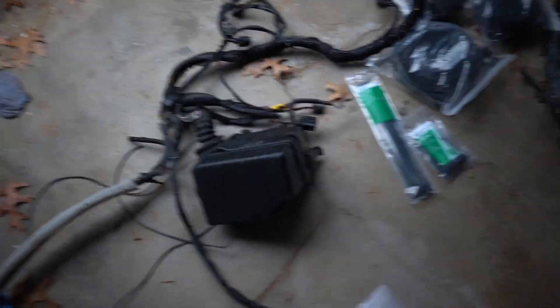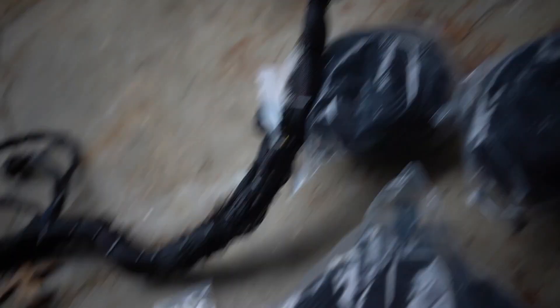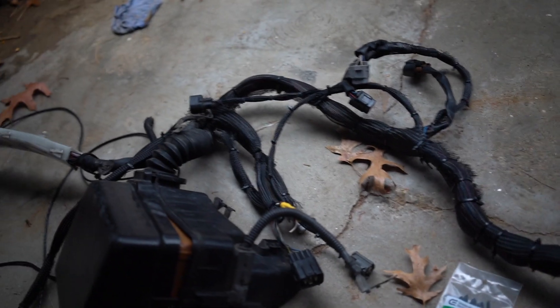At the end of the day I'll have a full 4 inch exhaust, which should be pretty nifty. I took my wiring harness out — not the engine wiring harness, but the engine bay wiring harness. I put it in this flexible hose covering stuff. It doesn't look the best but that's really the purpose of it — you're not even going to see it. I'm going to tuck the harness so you can't see it and extend my fuse box into my trunk and get rid of a bunch of connections I don't need, to clean up the engine bay. This hard-formed plastic fits behind the headlights, but I'm going to tuck it and get rid of it.